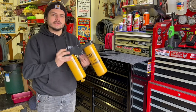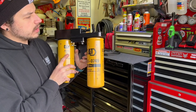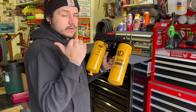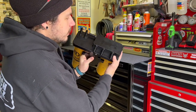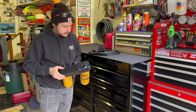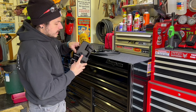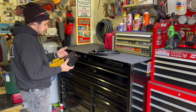Everything's labeled: you got fuel filter separator pre-chamber — we'll be reusing our sensor out of the old water separator filter underneath the tank. You got your fuel water separator filter right here. These three lines are all labeled coming off above where the system is now — basically we're going to reuse these. Then these two we're going to run as return lines coming back from the filter in the engine bay. This is a factory line, and there's a fitting plug here — this location is for the long bed, this one for the short bed quick connect fitting.